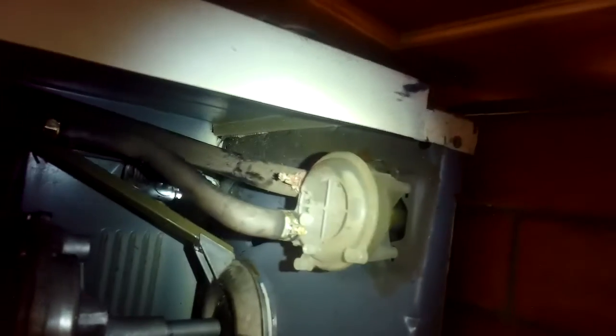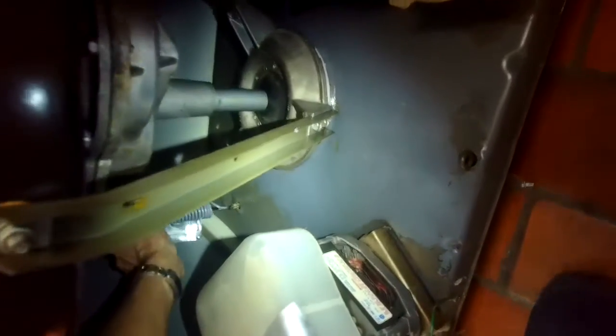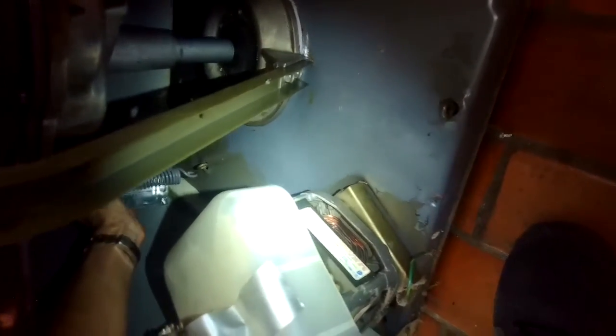So now we're going to take out the blocks, as the 15 minutes of glue time has elapsed. We're going to let the tub assembly come back down onto it. Still don't want to really use this for maybe 1 day to let that glue really set. So I'm going to reconnect the spring in the back onto the eyelet. If I lean the tub over to the back and left, that'll help me to get that on there. Again, if you have a second person to help, that'd be great.